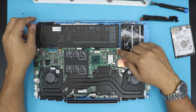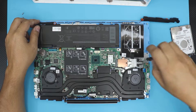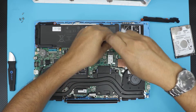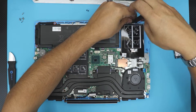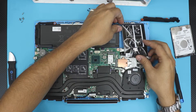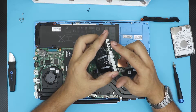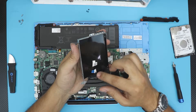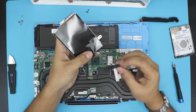Let's just pull the speakers out for a second — just lift it. Remove this one, this one, and the one at the back. You don't need to disconnect the battery; there's no need. Once you remove those, it's neat because they actually give you an extra set of screws to put the hard drive in, and there's the adapter to put the hard drive in.